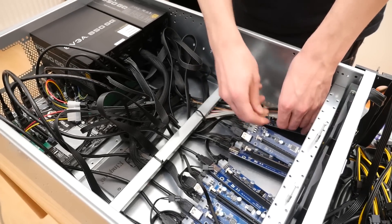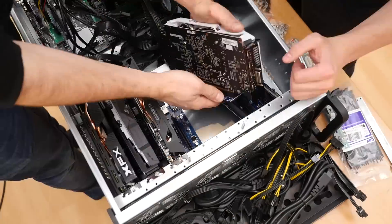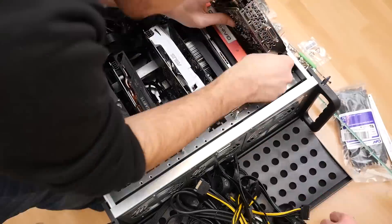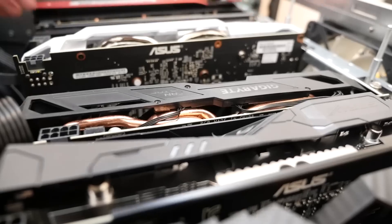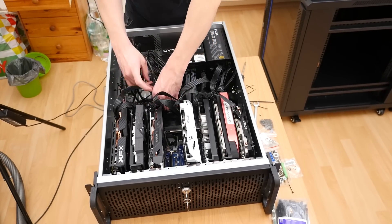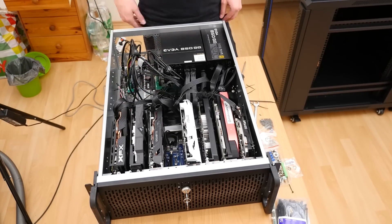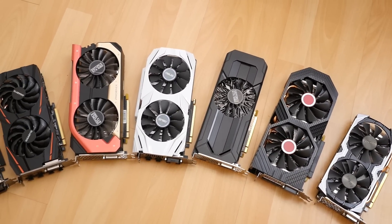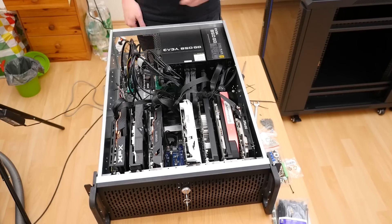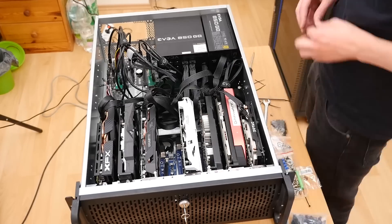The riser also needs some additional power from a six-pin VGA connector, but you can also use the included SATA to six-pin adapters to power it. Cable management is really hard with so many GPUs in such a tiny case, but it's important to think about how you arrange the cables because you may need to remove some for maintenance or troubleshooting in the future. We've now used seven different GPUs; we're currently waiting for number eight to arrive, which is a special mining card from Sapphire. It's not recommended to mix so many different GPUs since it's harder to manage overclocking and you have to mod a bunch of different BIOSes to get decent results. It's way easier to do that with one card from one brand and copy the BIOS to all of them for more stable operation.